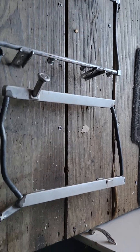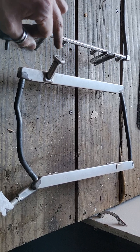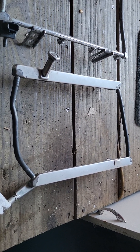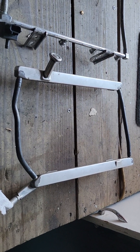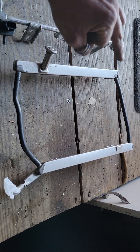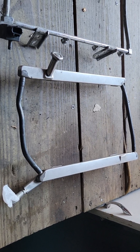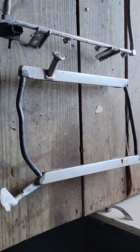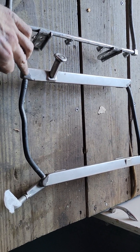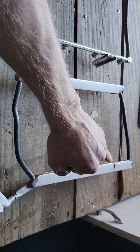When looking at the upgraded fuel rails, first we're going to go to this Freestar fuel rail. The pro is that it pretty much is plug and play for the Mustang intake setup, because you have to go return style fueling. Where the Mustang rail has a fuel pressure regulator in the rail, this one does not at all — and that works really good for low profiling. It will fit really good with just about any intake swap. If any one of them is going to fit on the Mustang with the original OEM intake, this is the only one that may fit, but you would have to go to return style rail.